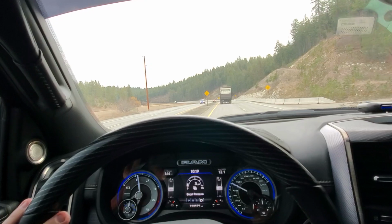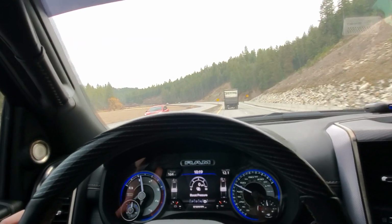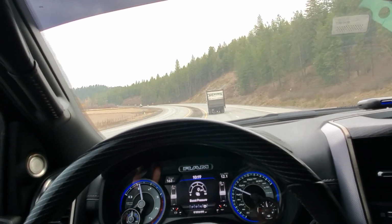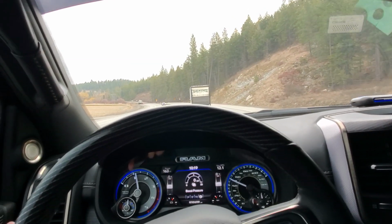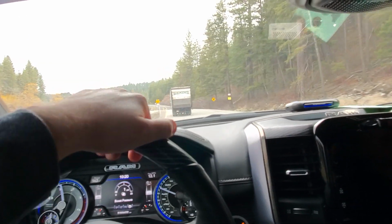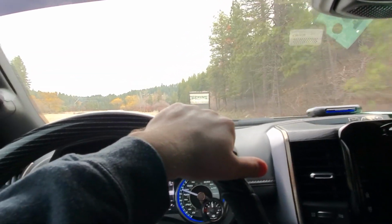And also, a side note, when you're adjusting them, you got to do it by feel. Feel your airbag. You should have some air in there, but it shouldn't be hard as a rock. You're definitely doing something wrong if it's hard as a rock. Mine, it's hard to explain, but I could put a good dent in the airbag just by pushing it with my thumb. So that gives you a good idea how firm my airbags are and what it took for me.